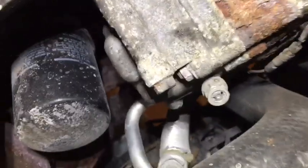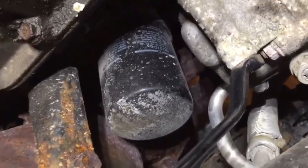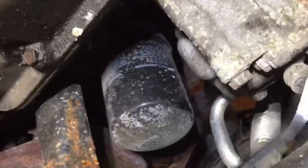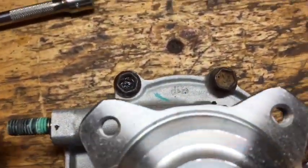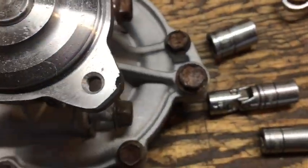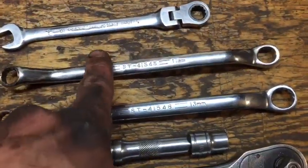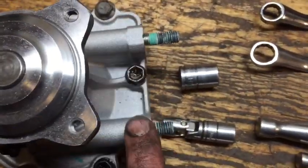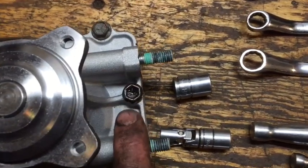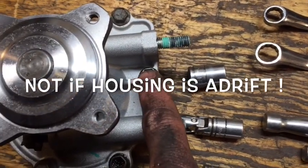On the pump side of the compressor there are four 12 millimeter bolts that need to be removed on basically the four corners of the compressor — they're going to be tight. All the bolts are extracted around the periphery of the flange: the periphery bolts are all 10mm, three bolts are 12mm, and there's also one with a clamp that's also a 12mm. You'll need every combination of ratcheting box end and offset 10 and 12mm that you've got, both quarter and three-eighths. The one between the two standoffs for the through-bolts is a real bugger due to its proximity to the block — that one alone took as long as all the other bolts combined.